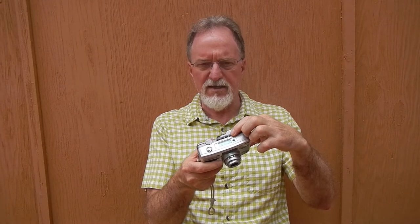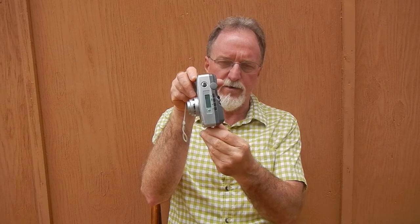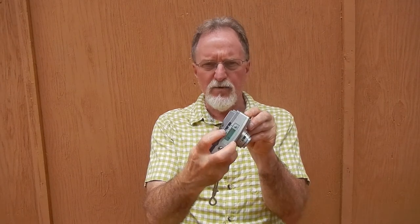It has a pretty good flash — guide number 15 meters at ISO 100. The flash button cycles through automatic, daylight sync which is fill flash, slow shutter with no flash for things like fireworks, slow speed sync where it does a slow shutter and a flash for someone in front of a dark cityscape, and bulb mode for really long shutters with or without flash. It also has a separate button for red-eye reduction — whether it does the pre-flash to contract the pupils or not. The button next to it toggles between single frame, self-timer, and remote control — that was optional, I don't have it.